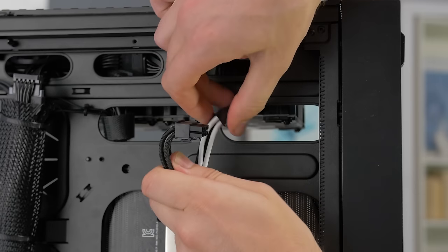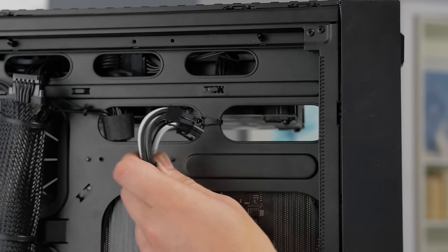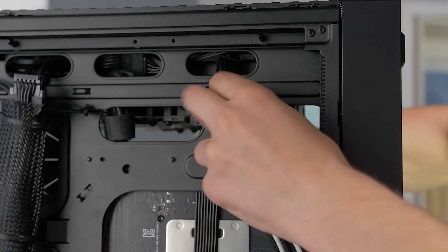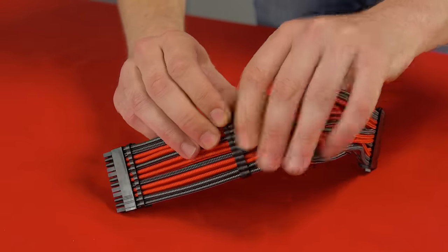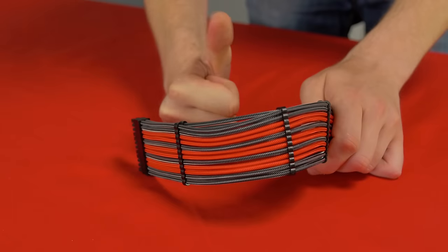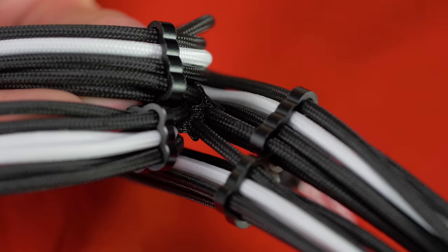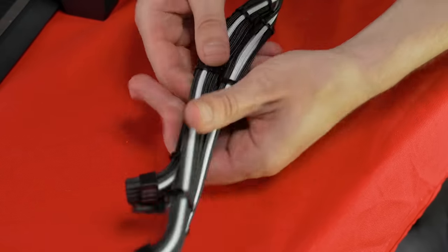When you're hooking these up, we actually suggest pre-bending the cables into the desired shape before you install them — it helps more than you might think. Last but not least, we mentioned cable combs: cable combs can be used not only to keep your individually sleeved wires apart, but to ensure that parallel runs are indeed parallel and they stay there.